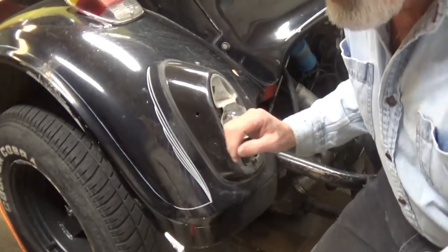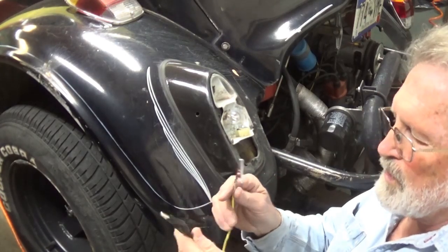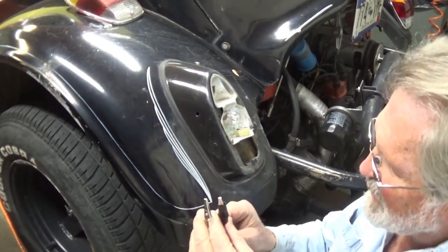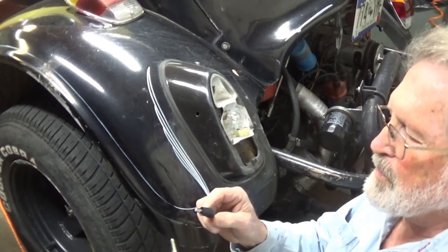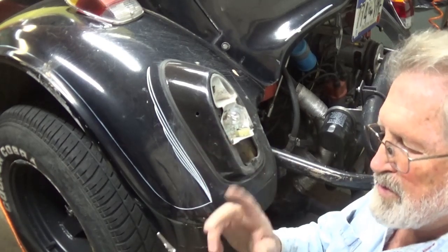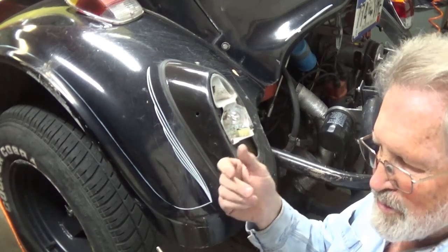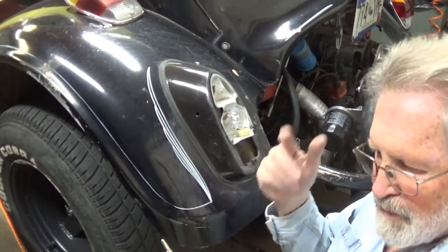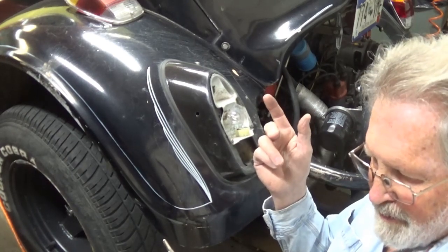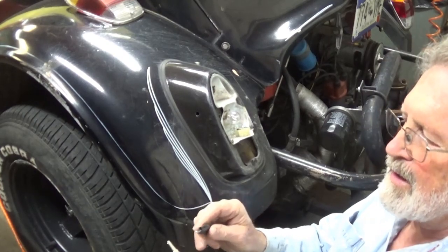That's quite a hassle for me to get the other end on the switch without taking the tire off — it's a bit cramped in here. I've put the test leads on the switch and turned my ignition on. If you can hear that buzzing in the background, that's my electric fuel pump at the front of the car. Now I want to check my brake lights — I can turn it on and off by doing that.